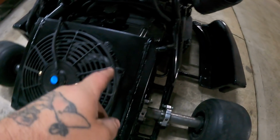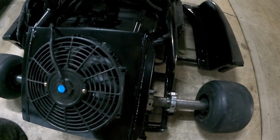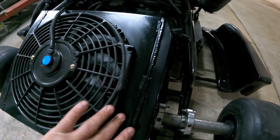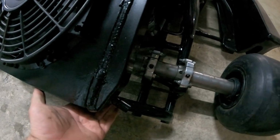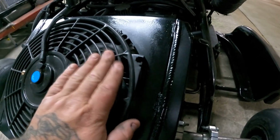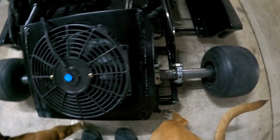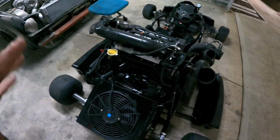One bad thing we've got here is unfortunately the corner of the radiator has got a little bit of a leak, and it's right on the end tank, and I can't weld it. I tried to get it in with the welder, but it just didn't do it. So unfortunately, we've cut the top off and just put a bit of epoxy in there, which has done it. Nothing's leaking, so that's awesome. It was only a slight drip anyway, and I've just smeared some silicone under there, so this is just siliconed back on. If it does leak again, I'm probably just going to order a new radiator. We'll quickly weld all this stuff back on, but we'll see if it lasts. If it does, it does. We'll go from there. I'll just make sure I keep watch on it. Okay, so that's all good.